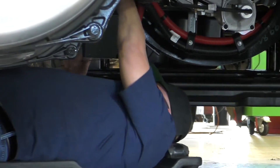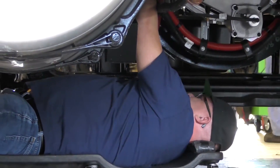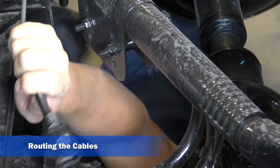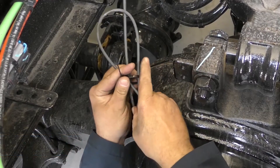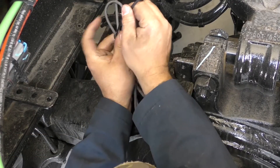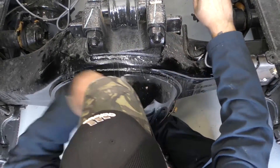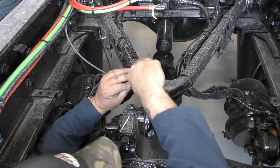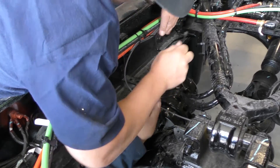After setting the AD values on your sensor, the sensor will require a break-in period that can last up to two weeks of regular use before calibration. Route the 40-foot drive extension cable along its respective axle and the frame and through the cab firewall. Leave enough length for sensor connections. If at all possible, route along an existing wire harness. Secure the cables loosely to the suspension using zip ties. Keep all cables a minimum of a foot from exhaust piping or properly shield the cables.